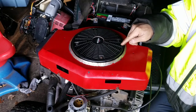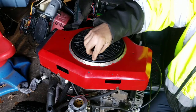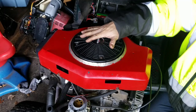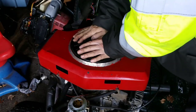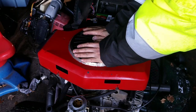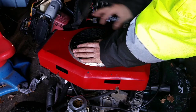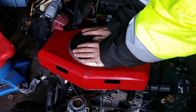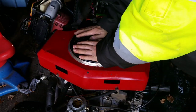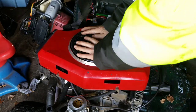So it wouldn't fit in there because it would hit the sides after I put this on. So I used my pliers and I just basically bent the sides upward. So now it actually looks like it's, you know, encased in there. So now it works, see? Nothing rubs. Smooth. Good compression. As a matter of fact, I think the reason why this abruptly stops at low throttle is because it has too good compression. The compression is too good because I think the pistons, because they're both slightly damaged on the side, are kind of rubbing on the cylinder wall, which isn't good. But like I said, I wasn't willing to spend a ton of money to get brand new pistons. I'm going to make it work. You know what I mean? I think over time, it'll smoothen out, hopefully.